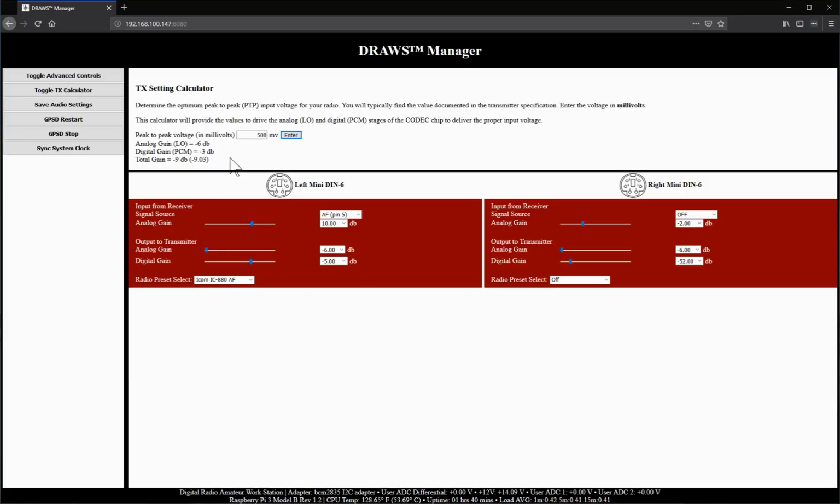As I say, you get to it either if you're on the Raspberry Pi with the browser, or through VNC using localhost port 8080, or you can do it over the LAN with port 8080. Just a word of caution, the operation of this tool runs as a privileged user, so you do not want to expose it to the open internet. So please make sure your firewall is blocking access to it if you are doing any port forwarding.